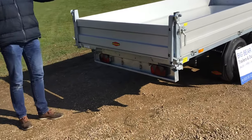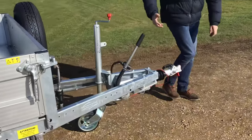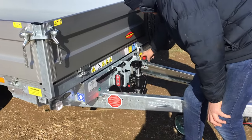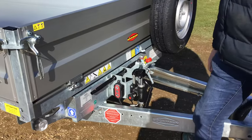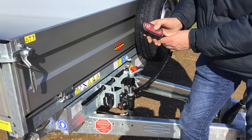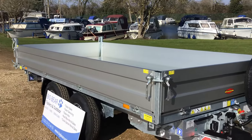If Kate follows me to the front, I'll just talk you through the working. So basically it's an electric battery with a hydraulic ram on. What we need to do is come to the front here. You have to turn the power on — we're just going to switch that on — but at the same time release the bed latch. There is a manual latch to ensure that's all good to go. Then we can come to the controller and power ourselves up by pressing the central button. Once that's on, we're set to rear tip at the moment, so we can now go to that.